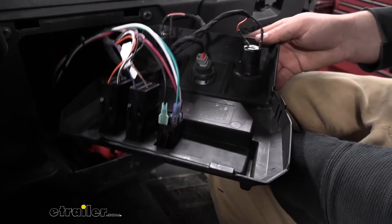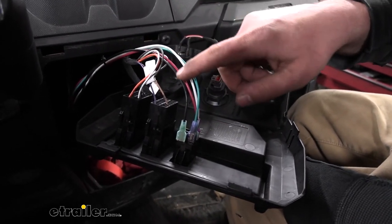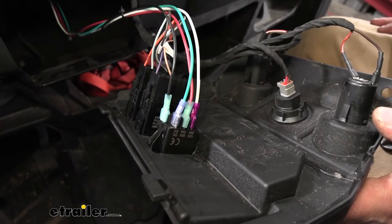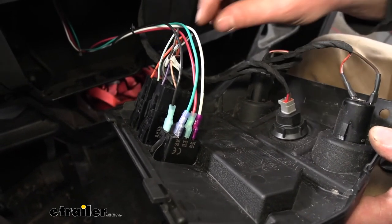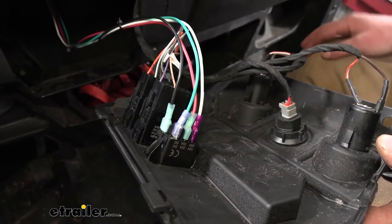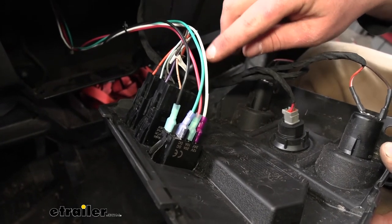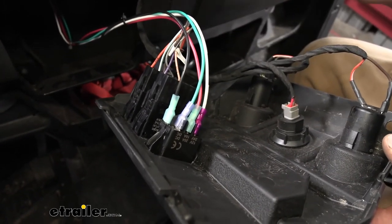There is a diagram on the switch instructions that you can follow, but it's really simple. The black wire goes to the ground portion of the switch. The red wire — that's our 12-volt power — goes to terminal 2 on the switch. You just crimp on these spade terminals and they push right onto the back. The green wire goes to terminal 1 on the switch, and that is for winch power out — so that'll make the winch go out, giving you more cable or rope. And finally, the white wire goes to terminal 3 for winch power in, so this one pulls your cable or rope in.